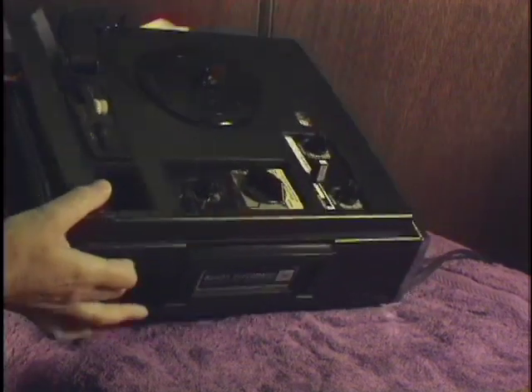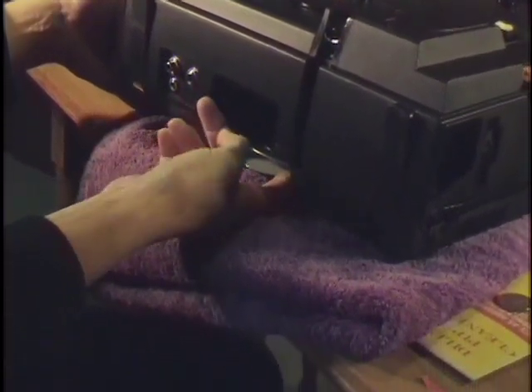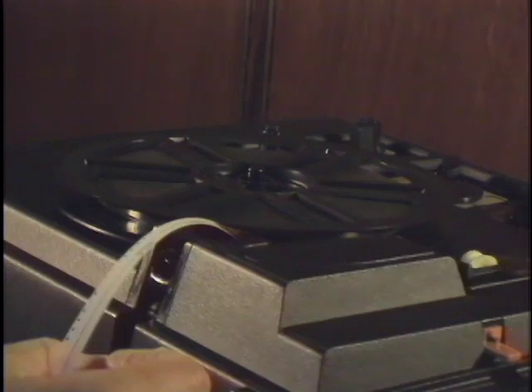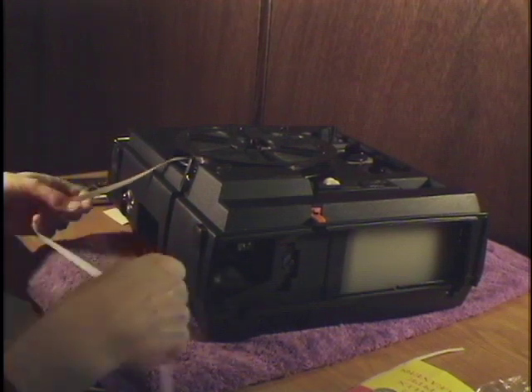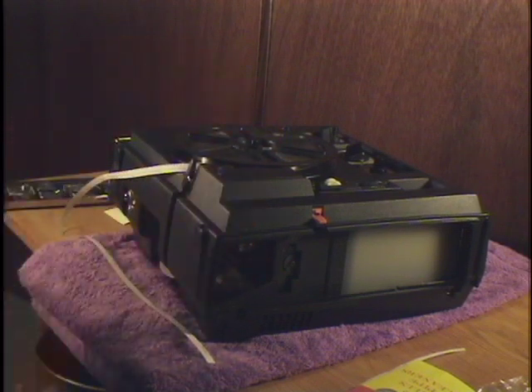Now it's locked. It is heavy like a tank. When you have film in the take-up reel and it's completely fed through, it's no longer attached to the top reel. You take the end hanging out, pull it up the pathway directly onto the top reel, re-secure it to the inside of the top reel, flip the lever into rewind, and it rewinds extremely fast. This projector is the gentlest on old film, the quickest to switch between Super 8 and Regular 8, and it's a real workhorse. The only handicaps are it can't take larger than 400-foot reels, and it is heavy.